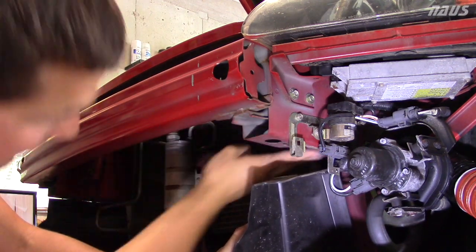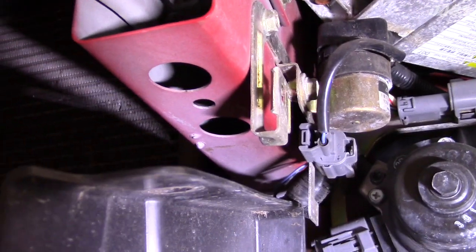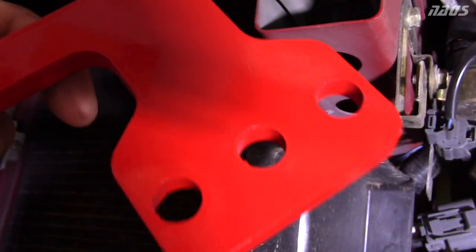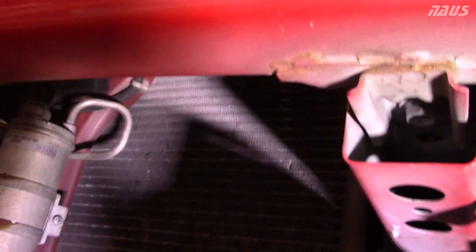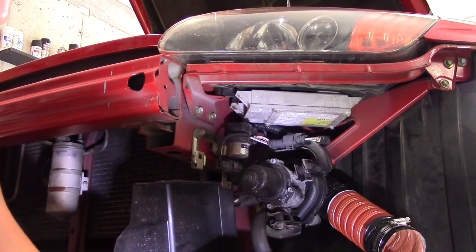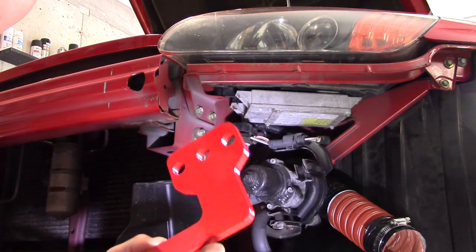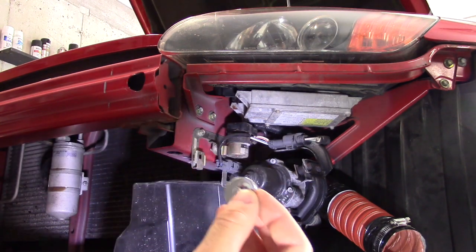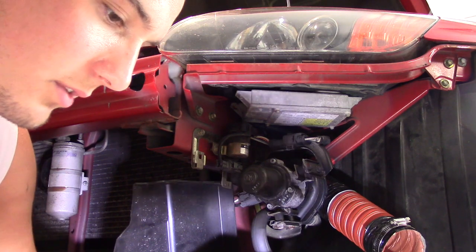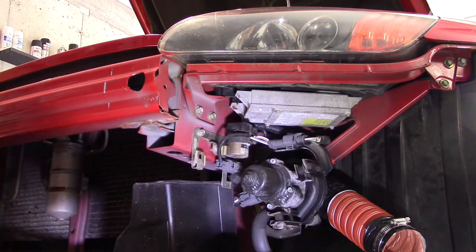You can see the surface to work with - you might want to clean that off while you have the chance to get any dirt off before you clamp these pieces of steel to it. The way this works is you have three holes - the two larger holes are where you're going to mount your screws through and your backing plate. One tip: I happened to have some 3/8 zinc-plated washers laying around. You're going to want a flat washer and then put the locking washer on top of the flat washer, so it bites into the flat washer and not the actual part itself. That's the one thing I can knock them on - they didn't include a flat washer and just expect you to bolt the split lock washer right to the painted surface, which is going to peel the paint right off.